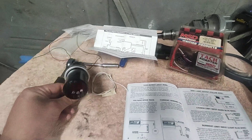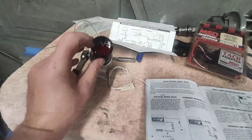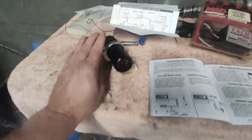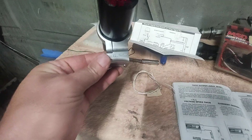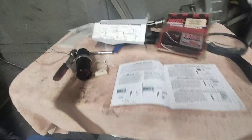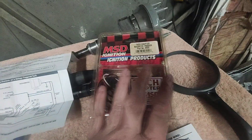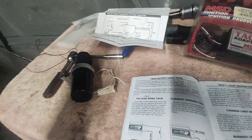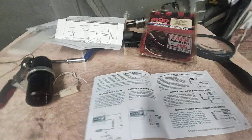I don't like the digital tach but it didn't bother me when I had the in-dash tach working, so I was just using this as a shift light. The tach does work in this unit because it's a real AutoMeter product, not an off-brand. Doing my research on what tachs actually work with an MSD ignition without requiring all these adapters, everybody said AutoMeter. So I returned the Equus one — it looked like an AutoMeter ripoff.